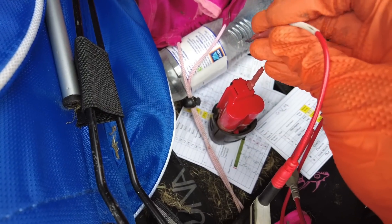So we'll go over to the offside rear and see if there's anything obvious at that caliper. About half an hour has passed — ended up getting talking to the customer. To cut a bit of time, what I've ended up doing — probably something you shouldn't do but I'm going to anyway — is we're just going to try and actuate the caliper itself from the interior. The wiring harness from the caliper runs up behind to more or less the offside rear taillight, where it joins a four-pin plug. We can test it directly there, and if nothing happens we can go directly down to the caliper to confirm if we've got an open circuit or a faulty caliper.